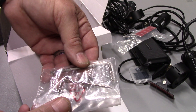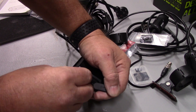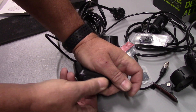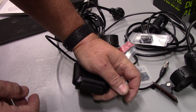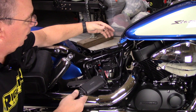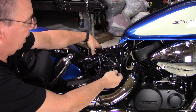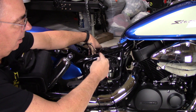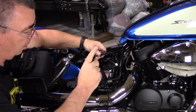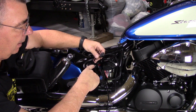It comes with a card reader, some extra 3M tape, and all the Allen wrenches you need to put it together. The micro SD card I'm putting in is a Samsung Pro Plus 128 GB — the same card I have in my Honda CRF300L Thinkware dash cam. I'll put the rubber plug back so it stays watertight even though it'll be under the seat. Now let's get it installed. On the right side of the Honda 750 Shadow Aero the fuse panel is right here, and I'm going to mount the DVR unit on top of the battery box using velcro so it's easy to remove. We have the front cable, rear cable, remote cable, and a power cable with a 2-amp inline fuse. Last thing will be connecting the power, then we'll be ready to try it out.